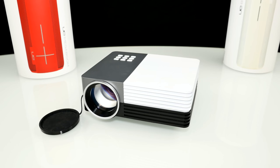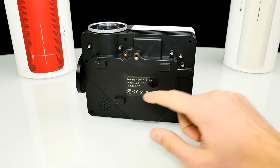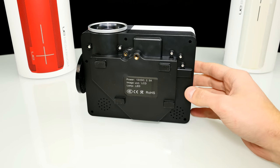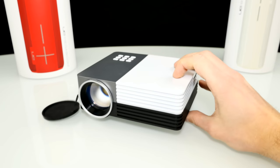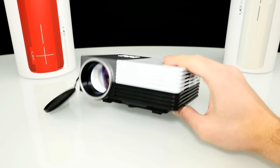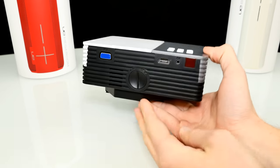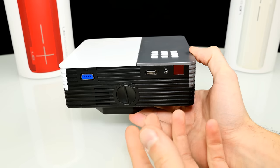Here's the projector and I did a review on this unit so you can check it out on my channel. Honestly, this is one of the worst LED projectors I've ever had. The power limit is around 30 watts but it's very, very weak. There are projectors claiming 1000 lumens, but this one is not even 100 lumens, so it has to be absolutely dark in your room. It has VGA, HDMI connectors, supports full HD resolution, but the native resolution is very low.